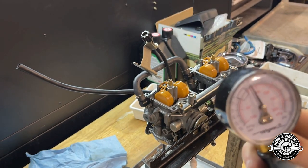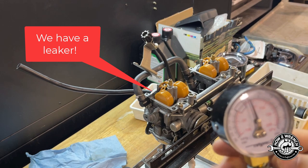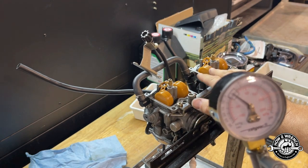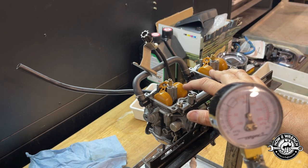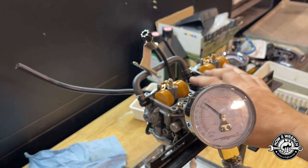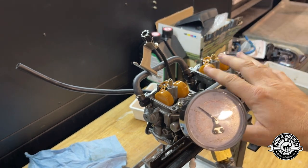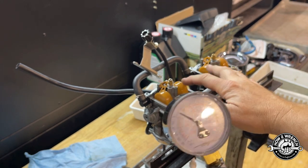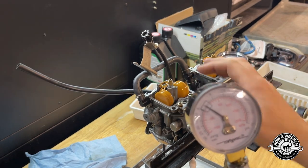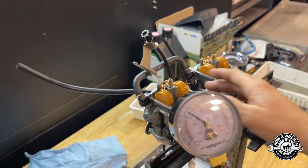Without any fuel to hold them down — remember it's only gravity holding them right now. I like to do a kind of pop test. I'm physically holding those floats, I can crank it up, and then I just pop it like that — I want to hear that really fast swoosh. If it was just slowly coming out there could be a problem or restriction. So let's try it on the other one — crank it up and you hear that? It's definitely holding pressure, and when I intentionally release it, it takes all of it and dumps it immediately. That's what we want to see.